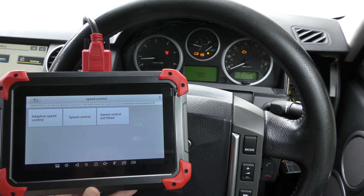The last set of lights are the ABS, brake, and traction control warning lights. They fall under the vehicle dynamics control module — essentially the ABS system. Read trouble code: we were getting a problem with the front right wheel speed sensor, also known as an ABS sensor, which has been replaced. Even replacing the sensor isn't always enough to turn off the warning lights — you may need the tool to reset the codes. On a lot of vehicles you can just start driving and the lights turn off automatically, but the fault codes always remain in the ECU until they are reset.